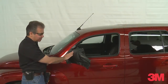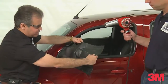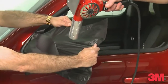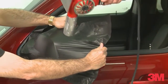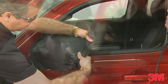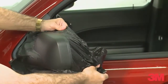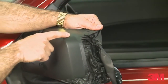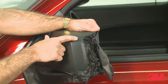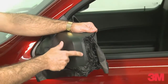I've wrapped the face of the mirror as we would normally do. The beauty of this new technique is when we heat it, the film will actually begin to shrink around instead of stretch. Now the areas that were susceptible to fingering will no longer be an issue, because as the film gets warm, it actually shrinks and wraps tighter around the edges.